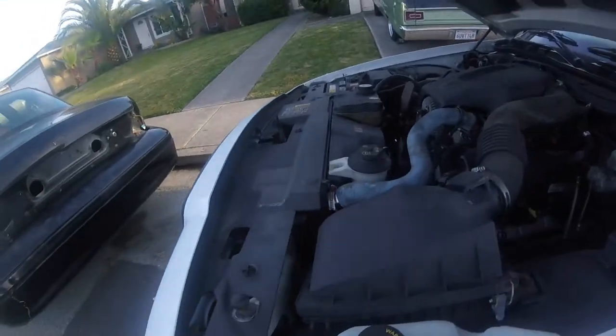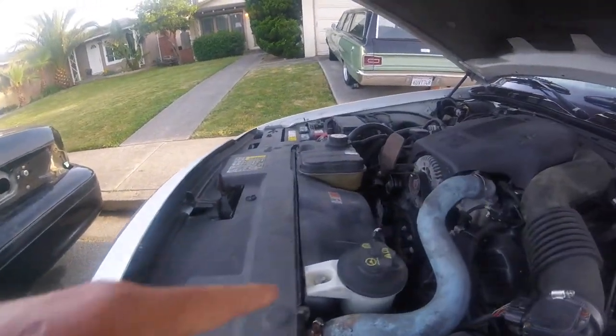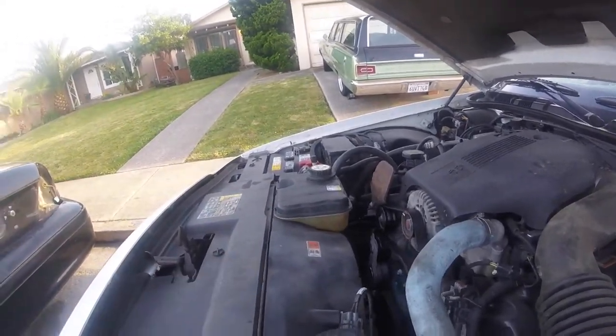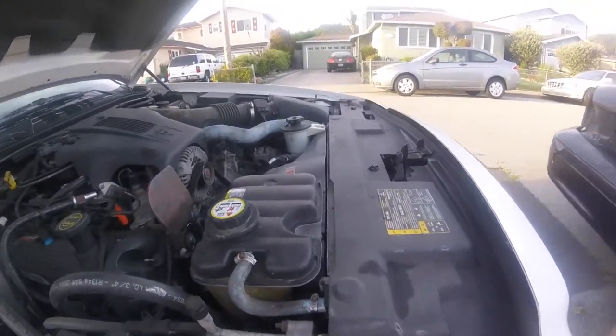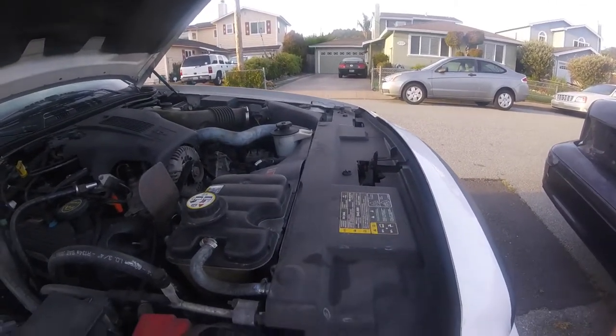Alright, white car is all put back together. Got everything reinstalled — looks just like factory with the addition of the blue silicone hoses from the police Crown Vic. While I was in here, I also replaced the belt, tensioner, and idler pulley, because the belt was old and those two pulleys are usually problematic at high mileage. Everything fits stock, though I forgot the pieces that go along the side, top and bottom between the condenser and the radiator — I'm not sure if that makes a big difference, but it should be okay. Pretty easy project — everything's back to normal and the car's running well, so I consider that a win.